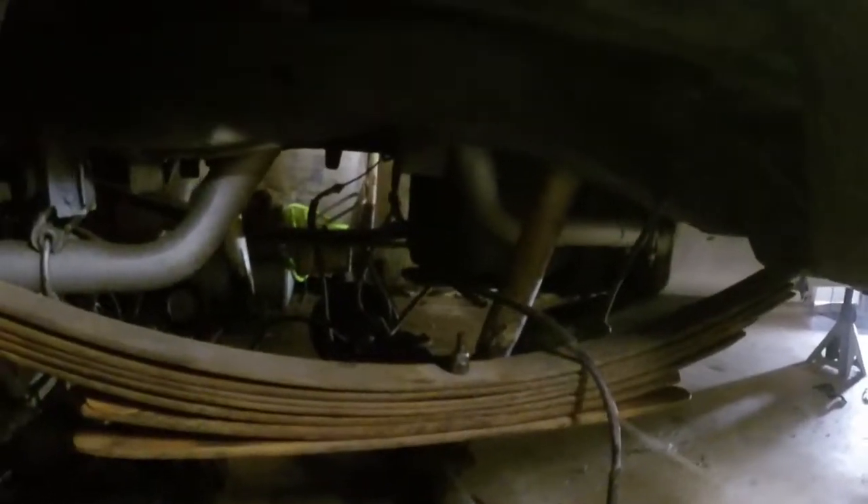I messed around for a while — went to the junkyard and bought some F-150 rear leaf springs out of an FX4, thought that would give me enough lift. I added them to the Ranger and I've got eight leafs in there now, which looks ridiculous and would ride absolutely horrible. It honestly only lifted the truck maybe an inch, so it did pretty much nothing.